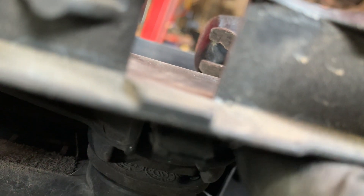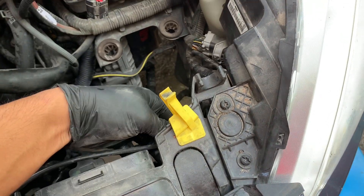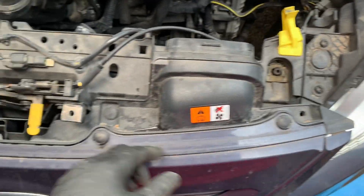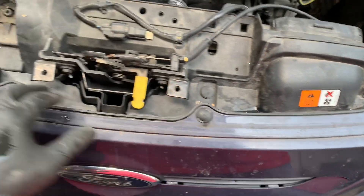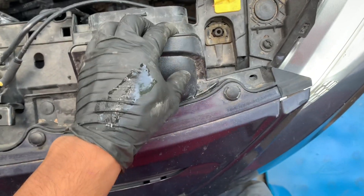Now that the fan is removed, I'm going to start getting the radiator out. You're going to have to remove these here. Down behind here — if you're looking straight at the vehicle — you're going to push that tab down and pull forward to expose this grommet here, and do the same on the other side. Some people say you'll have to remove this entire plastic portion to get this one, but I just removed the one on the side next to it and pulled back, which gave me enough clearance to pull it out.